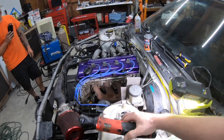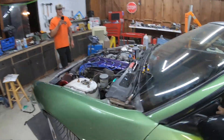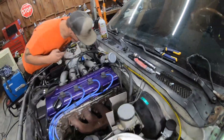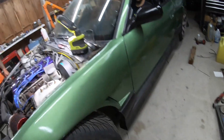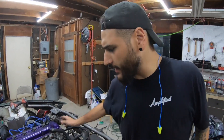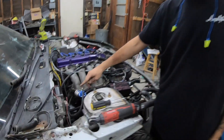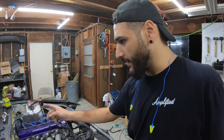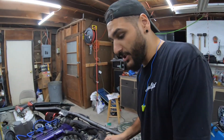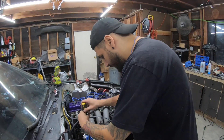It sounds kind of smooth — oh, a little shaky. Very track. It sounded smooth for a second and then got rough. All right, she started and then ended up dying. I came back and double-checked a couple things — we didn't have a ground done. I added a little ground and I think that helped. But also I think the fuel pressure regulator lines are backwards. When we fired it up again it sounded a lot smoother, but the line was pulsing super hard. I'm going to try swapping the lines on the fuel pressure regulator — it also shows zero pressure, which obviously it's not at zero.